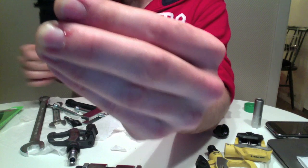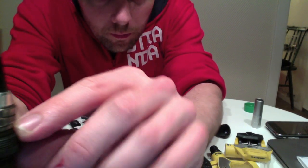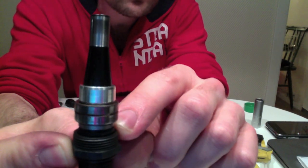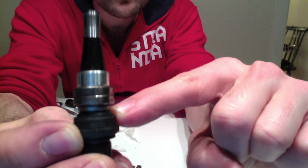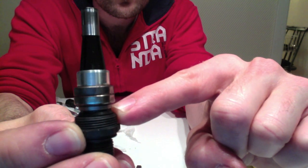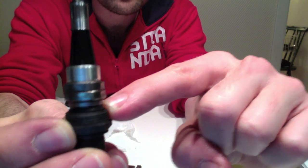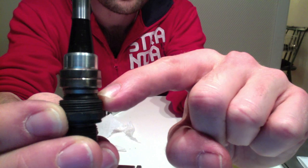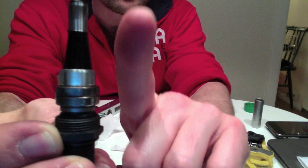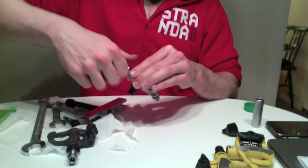that metal bit there. Perhaps something to point with, which I don't have. Sorry. Oh, there's the camera. This metal bit that my fingernail is pointing to, that's a spacer. Okay. So you're going to put this metal bearing puller just behind it. It's going to grab on and it's going to pull it up like this. Tighten this up.